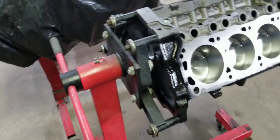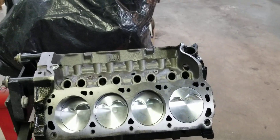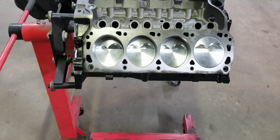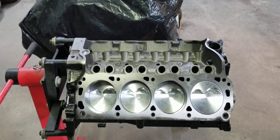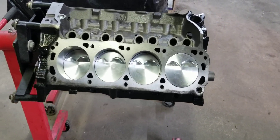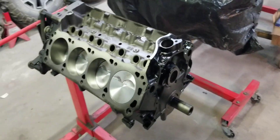We're going to see if this motor can make 350 horsepower, 375 horsepower, maybe 400 horsepower — maybe 430. You guys are saying 430 with factory parts — no way. Yes, here at Big Dogs Performance we can get them to do that, but this one is going to have factory parts that are ported. Everything is going to be ported. We're looking for maximum effort with factory parts — working that manifold, those cylinder heads, and that throttle body, with the cam retarded 8 to 10 degrees.